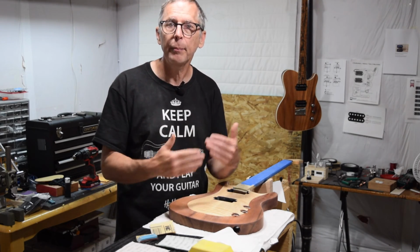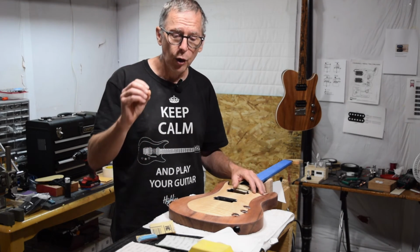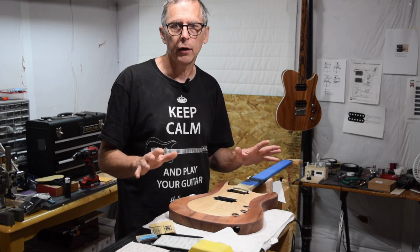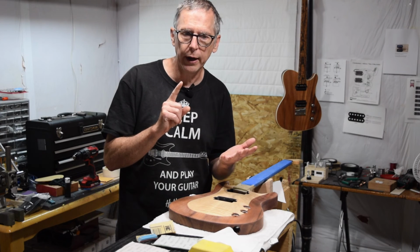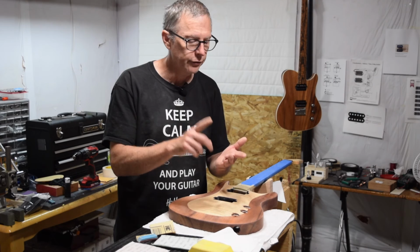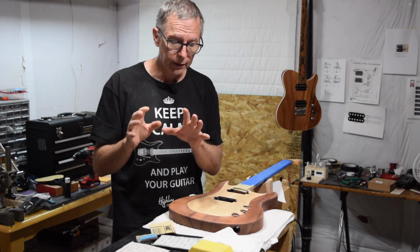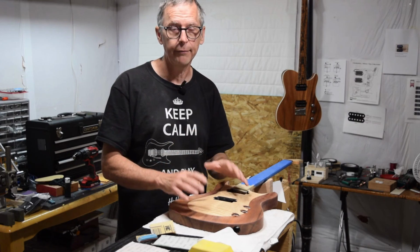sanding and polish sanding. In the past we've been using wet sanding techniques, which work really well, but with the advances in technology behind these new abrasives, you can omit the water and do a dry sanding technique. And it doesn't matter whether you sprayed a water-based polyurethane like I did, or nitrocellulose, 2K poly, or polyester. This level sanding and polish sanding technique will work for any of those clear coat type finishes.